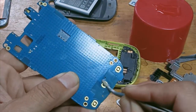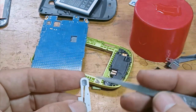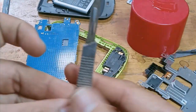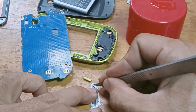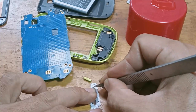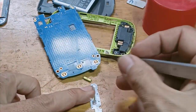I've finished processing the copper pads of one key button. Next is the key cup. Its function is that when you press the button, the metal part of the key cup closes the circuit between the two copper pads. Here I'm using a knife blade — you can use a razor blade or craft knife — to scrape the key cup. The key cup being dirty will cause it to lose contact. Scrape it clean. On the mainboard, you should not scrape the copper pad area — only scrape the key cup part.